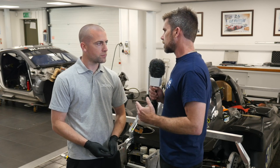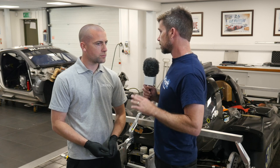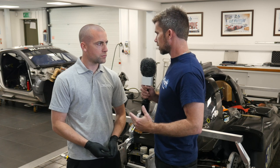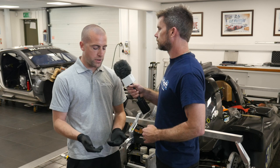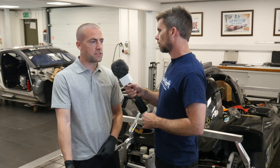Off camera we also discussed setting up spare components. Once you've got your suspension set up correctly, you can go through and measure the length of all the pushrods — along with track arms and camber shims — and that allows you to pre-set your spare corners. In the event of an accident or damage in a race, you can then fit your spare corners straight away and ensure the car is set up correctly. If it's not measured correctly, the car could go out and just not handle.